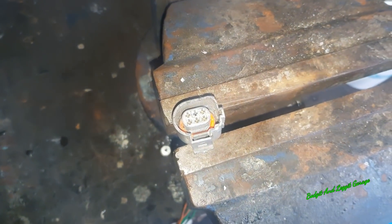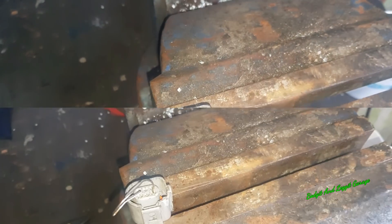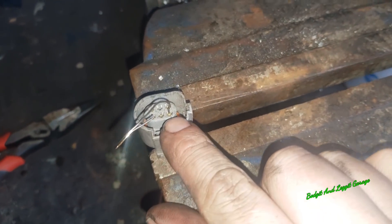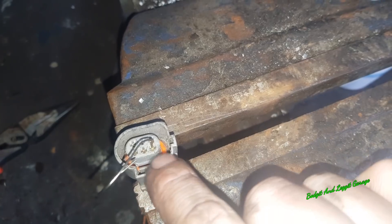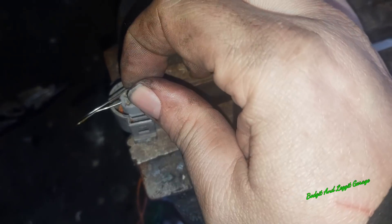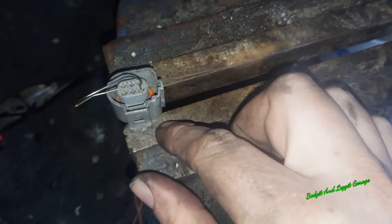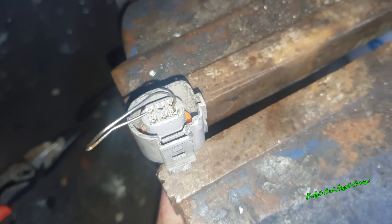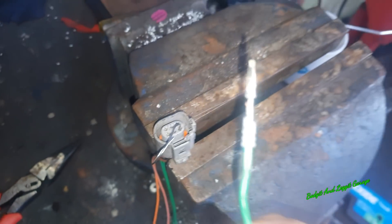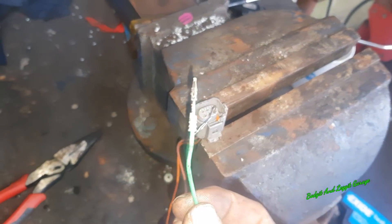This is the easy one because it's on a bench — the one that's inside the vehicle is going to be a nightmare. So as you can see, no specialist tools — I've got a paper clip and some pliers. I haven't gone in the middle of the clip; I've gone on the outside where the two little notches are cut out. Push it down, you feel a little bit of resistance, then come underneath, make sure you get the right wire, and there we go — we have de-pinned that connection.